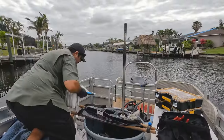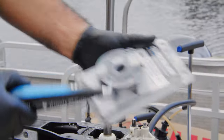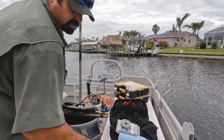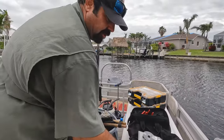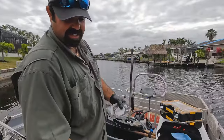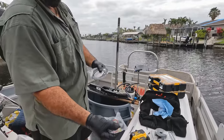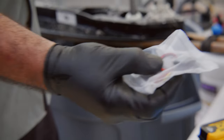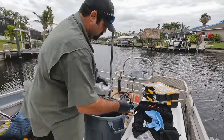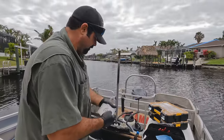The next step is installing the water pump kit. This is just the impeller kit — a pretty standard kit for Mercury. Pretty much 99% of Mercuries use that. Here's where the seals are — the drain and fill seals come with this kit, along with the collar and the couplers tucked up underneath for the water pump tube. Sometimes there are extra parts for other models.